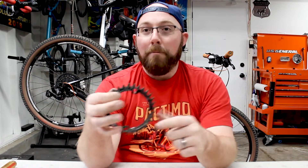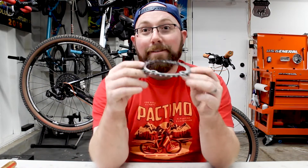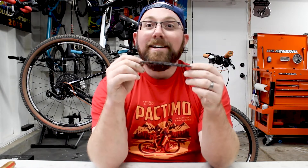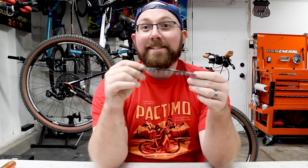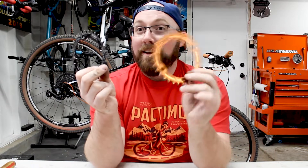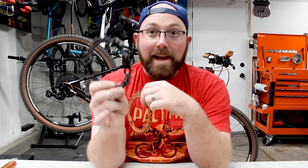The road bike chainrings worked fine — I never had a problem with them. The mountain bike one, however, is actually bent. Just a slight bend, but it's enough that while riding it messes with your rear derailleur, messes with the clutch, and makes your shifting not nearly as precise. It took me a while to figure that out — actually not until I was going to swap back to a round chainring.